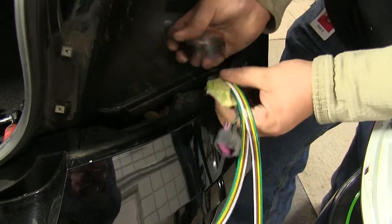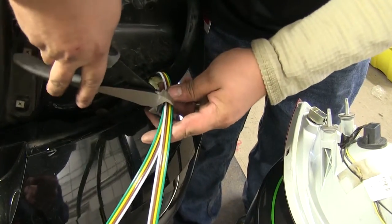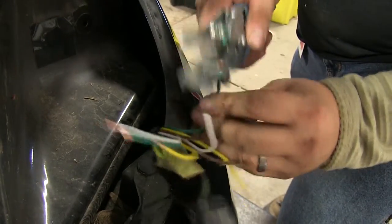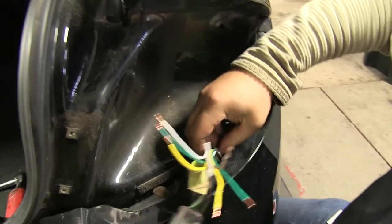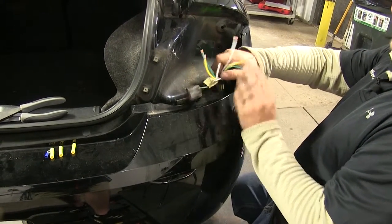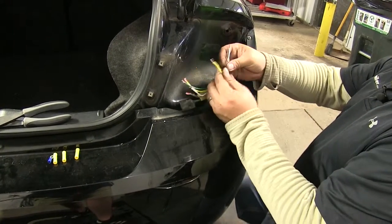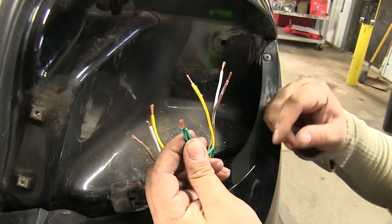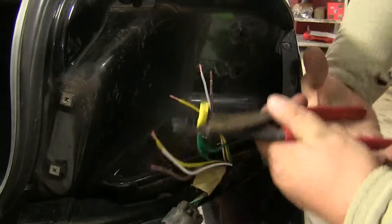I've got my loop from earlier, and I'm going to tape the wire in place just like I did on the other side so we don't lose our wires. I'm going to cut this to the length of our plug and split these apart. Just like on the other side, I'm going to strip all the ends. I forgot to mark it, so I'm going to reach underneath and tug on the wire going from this side to our other taillight to figure out which one it is. We're not going to use the green wire on this side, but if you can't figure it out, it's fine to put those two together since it's not going anywhere from here to the other side. I'll twist those together and use one of the yellow butt connectors from our kit to crimp it in place.